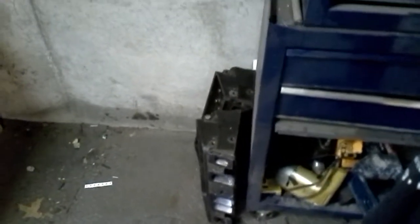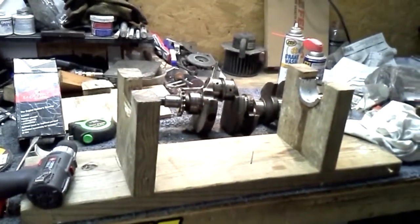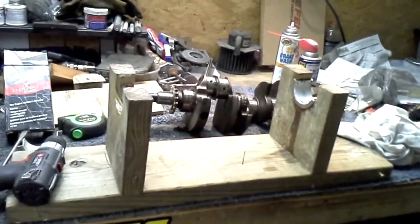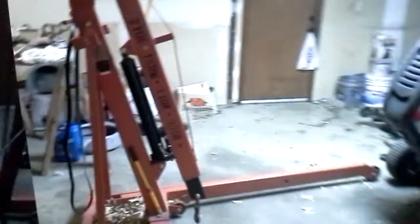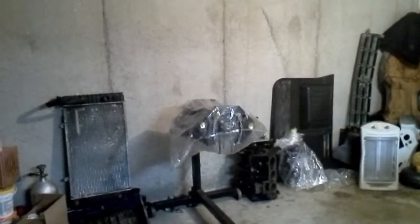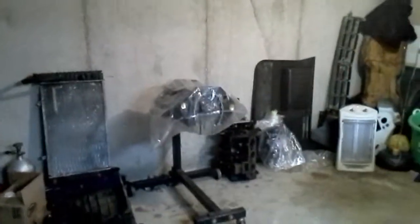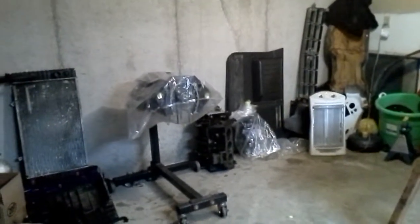The heads — they're down there, probably about 65% done. Still got more tweaking to do on them. We've got to finish our fixture first and see if we can get those two journals out to spec. Then we're probably going to mic and start checking our rod bearing clearances. I just wanted to let you know that we are still working on it. I apologize that every time I seem to show the engine block now it's in a bag, but it's super clean and we want to keep it that way. Anyway, that's an update on the turbo 4.3 build. Hopefully we'll be able to get this thing rolling a little bit faster and with more detail in the next video. Thanks for watching.